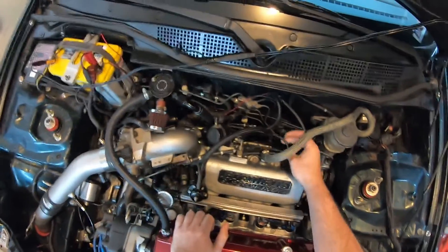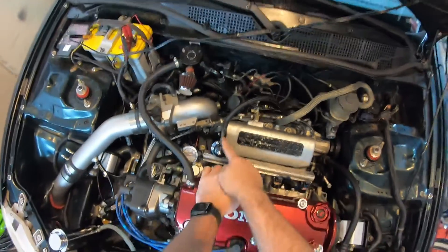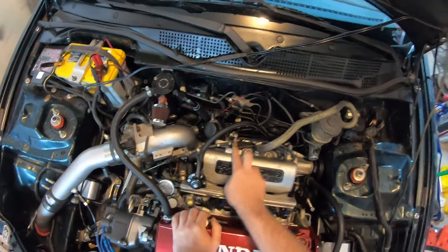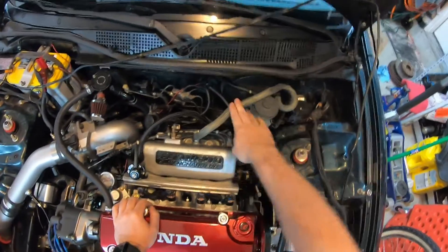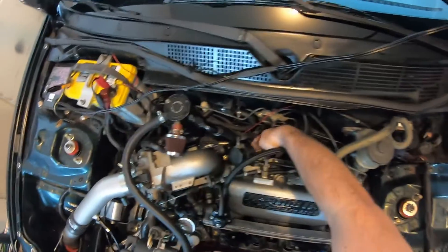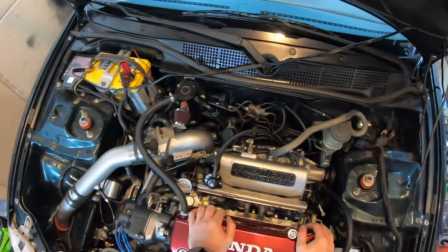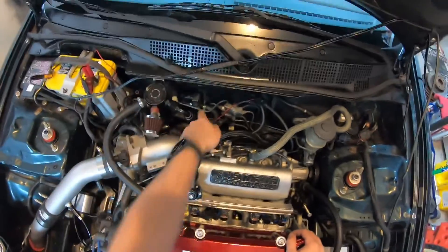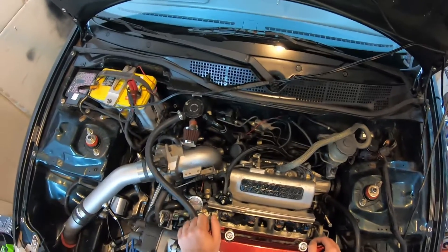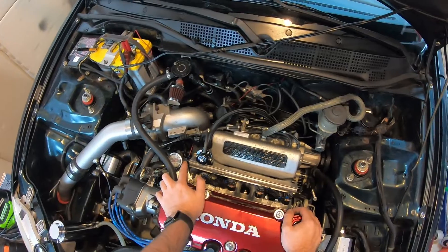This is running to the four-bar MAP sensor, and the T here is running back to the emission system because I have to keep that based on where I'm living. This other line is running over to the AEM fuel pressure regulator so it can rise with the boost level. This line here runs to my boost gauge inside the car, this one runs to the brake booster. On the valve it runs down to another nipple where the intake tube connects to the supercharger — that's where you run that. This line here is running to the purge valve, which I've relocated. Normally it's down behind the alternator, but I just wanted to make stuff easier to get to.